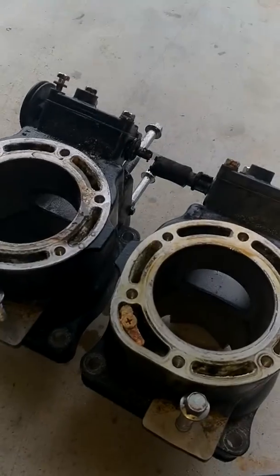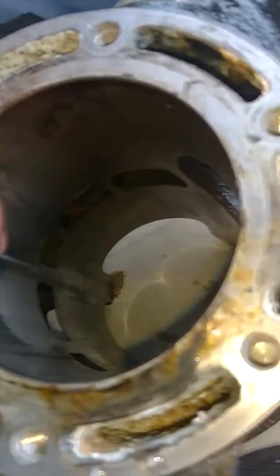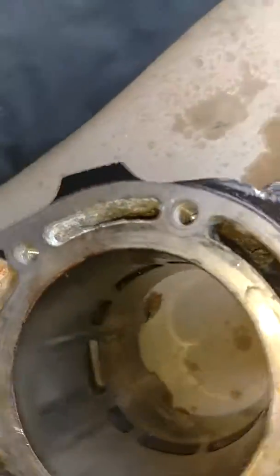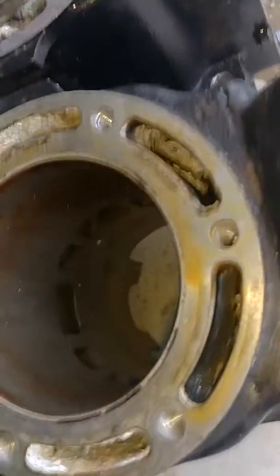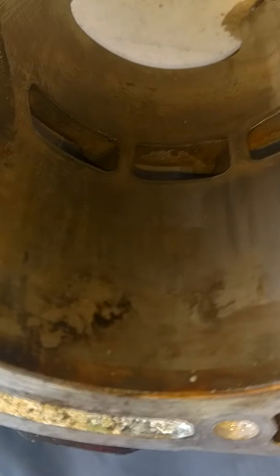This is the connector here that was in between. So anyways, this is the one with the bad cylinder in it. You can see the grooving on the cylinder wall there — the front one. So it should look like all the way around here. This is the bad one. There's the lines in it. As you can see, there's actually a little bit of material farther down there that's actually stuck to the cylinder wall. So that's probably what was causing all the damage to the piston and even the lines.